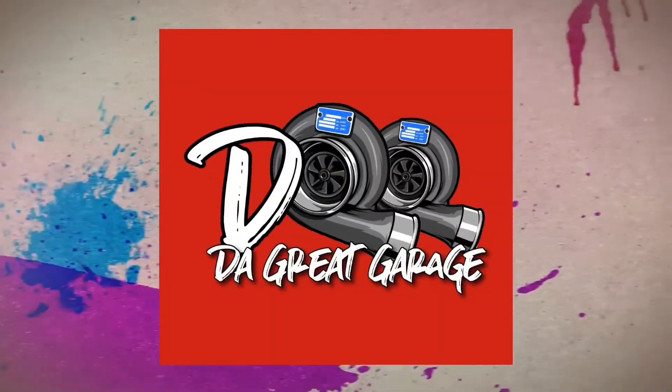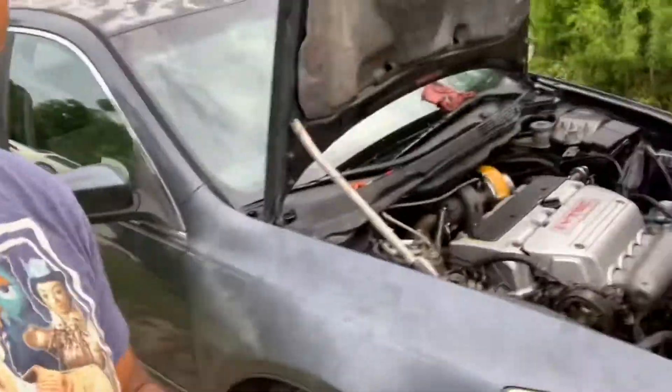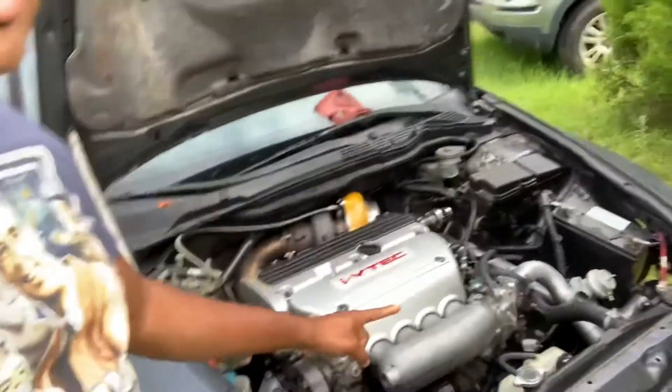What's good everybody. I don't have any beard and I have a wave cap on, so y'all know what that means — I'm doing army stuff. That also means I'm at Brian's house working on the Accord. We're about to continue with the troubleshooting. What I'm about to do right now is take the valve cover off because we're gonna check the timing to make sure all of that stuff is squared away — the whole P0341 thing that I've been fighting with.